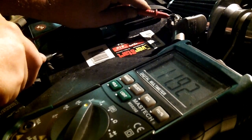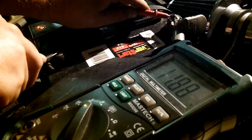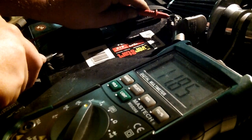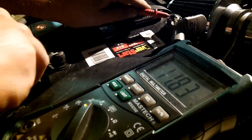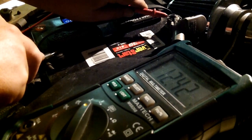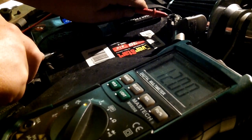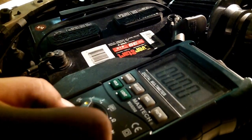So below about 12 volts at idle, his system voltage should be around 13 to 14 volts, preferably 14.3 to 14.7 while the car is running. It's at 11.85 with all loads on — his alternator is shot. With some gas it comes back up to 12.1, 12.2 and the charge light turns off. Release the gas and it slowly declines with all loads back on — down to 12.2 — and the light comes back on. That is how to diagnose a bad alternator.